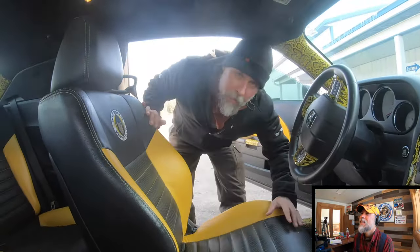So now look, what happened now? Now my traction control light is showing it's on. I'm not moving, so I'm not sliding. What it would do is it would go on, and then all of a sudden it would go off, and now it's just staying on. When it was really acting up, the truck wouldn't even go in drive. It would only go in fourth gear, and some of those times when I was pulling out, it was in fourth gear. It wouldn't shift out of fourth gear.